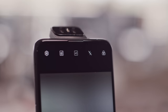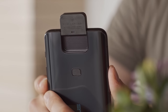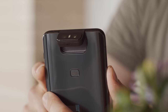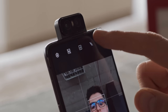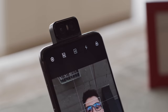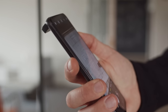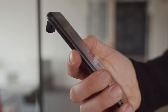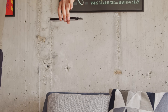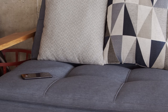The flip camera is definitely one of the highlights of the Zenfone 6. It's motorized and makes use of a rather complex gear mechanism, so the stepper motor can achieve varying amounts of torque and speed during the module's flipping action. This design freed the engineers from having to fit a front camera, and on top of that, it means great selfies. You can switch between back-facing and front-facing positions with just a tap in the camera app, or use the volume keys or the manual slider to position the camera at whatever angle you like. The phone attempts to retract the camera, or at least move it to a safer position, if it detects a freefall. Asus claims they've tested the module's durability thoroughly, and it's good for at least 100,000 actuations.